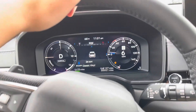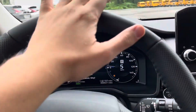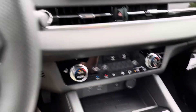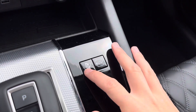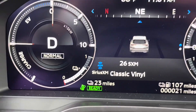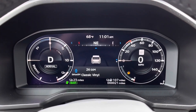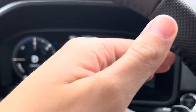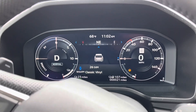Something else we have on this vehicle is our One Touch pedal system — that's pretty neat. It's going to put it to the point where the car feels like it's in B4 or B5 all the time. Mitsubishi just added this in for the 2023 model year — I haven't seen it much elsewhere yet. We have our neat little button here with our drive modes. If I hit this button, there's a neat little indicator that comes on in the dash. It won't even let you put it into B with this because it's already regenerative braking every time you let off the gas. These paddles are essentially useless when you have the One Touch system on because it's already on, with the default regenerative braking strength feeling like B4 or B5 all the time.